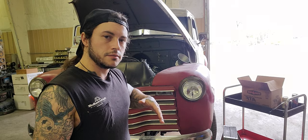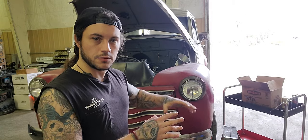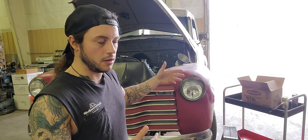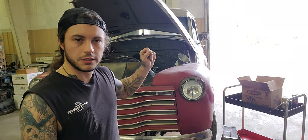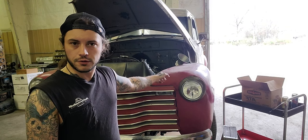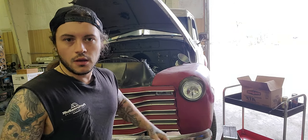In the past, I've put 10 quarts into it, and that's what it took. That's with my setup, which is running the cooler that we give you for free. We're running an 11-inch torque converter in here, LT-based, and a level 3 4L60E, which I converted from a level 2 700R4 because it felt like it.